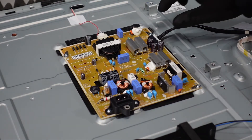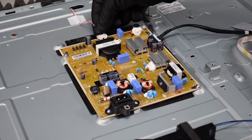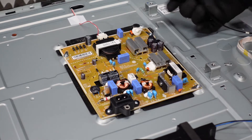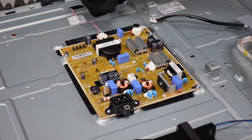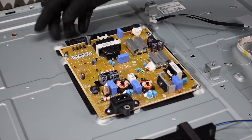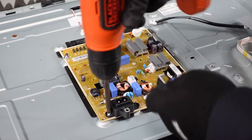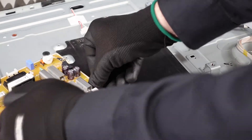First course of action at this point is our power supply. We've got a clip here on the side and a clip up on the top. The one on the side, we're going to pinch it and pull it out. Be gentle with these, be patient — it should come out just fine, though sometimes they'll give you some grief. This one up top, we're just going to pinch it with our thumb to release the latch and then pull it straight out. Then we've just got a handful of screws around the outside. That should be our power supply and we're good to go on that one.